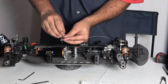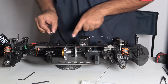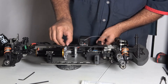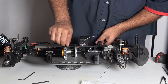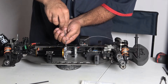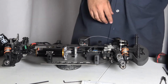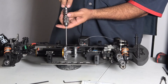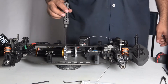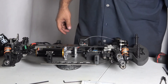Then you have these two long bolts that sit on top of this. There's our Ironman mount — there are four slots in there, four holes depending on how far your motor needs to go. You just select the two that you want depending on your gearing. Once your mesh is good, this is what tightens up at the end — you lock that up, lock the grub screw up, lock up these two bolts, and that's it. Bada bing bada boom.